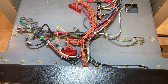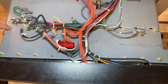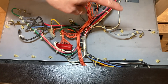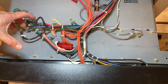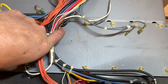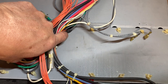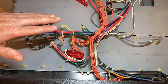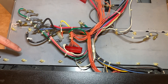I thought about removing the clips from underneath, but there are some spots you could not reach. So I came up from the top and removed the four 5/16 screws on this panel. This allowed me to lift the board out ever so slightly, but you have to be careful because there's a little grommet there with wires hooked up. You just lift the board up ever so slightly and it gives you enough room to unclip it.